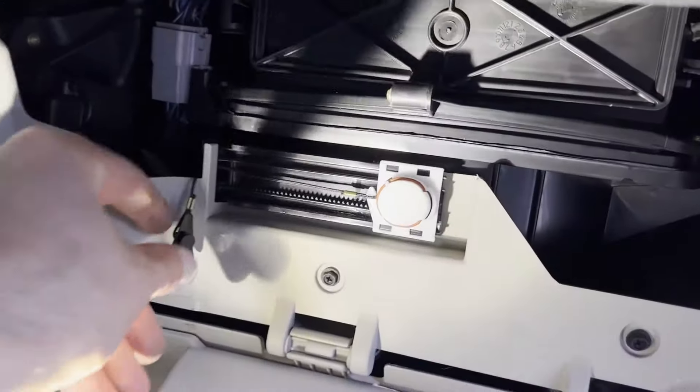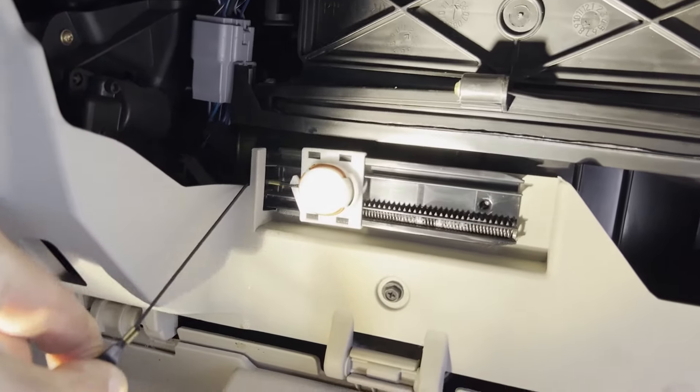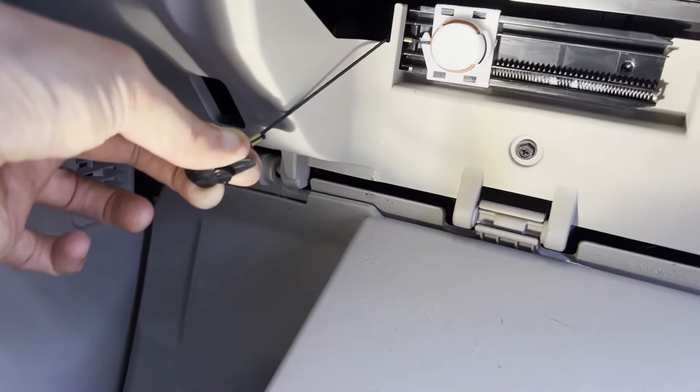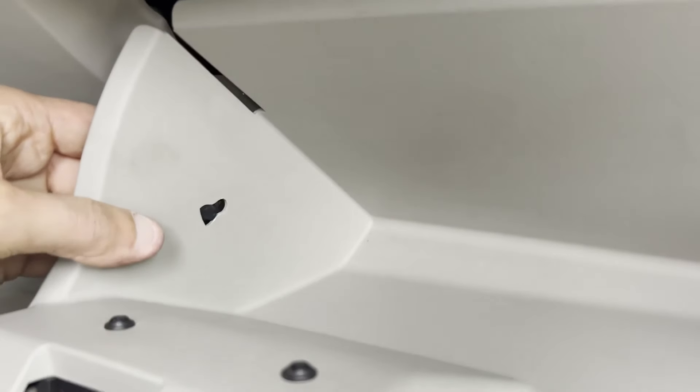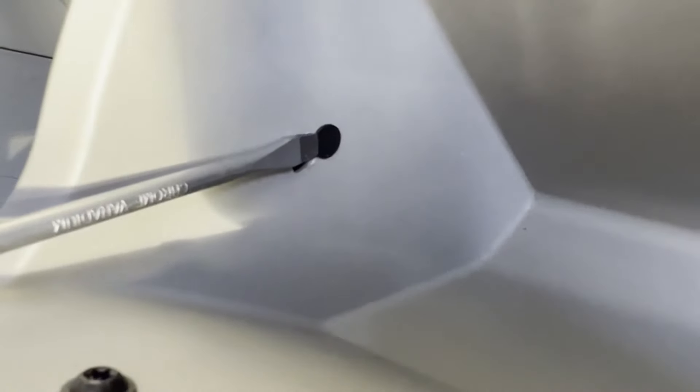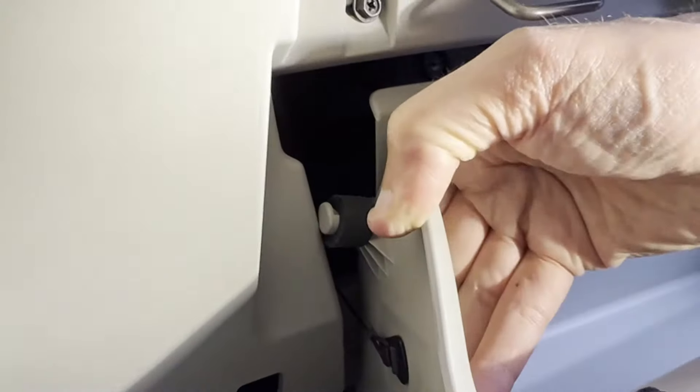Now I'm showing the soft open piece — pull it out of the way and lift up on the glove box a little bit and pull it off to the side. Then reconnect this piece by sliding it in. This is a little hard to show because I'm using two hands at once trying to lift up the glove box, but lift it up enough to slide this piece in place and it should pop in. Then slide it forward a little bit, probably utilizing that same screwdriver, and it should pop fully in place. Then squeeze the left side over — it's flexible plastic — squeeze it over and pull it up in place.